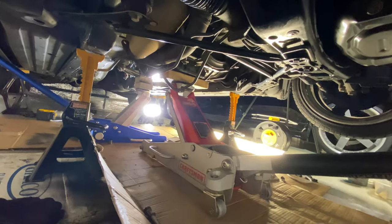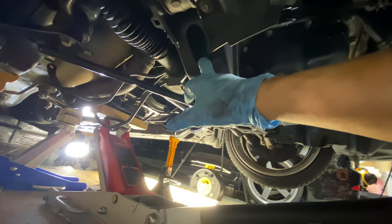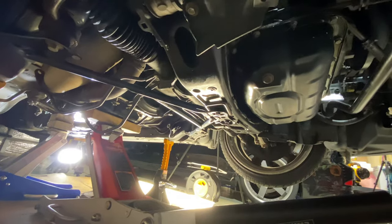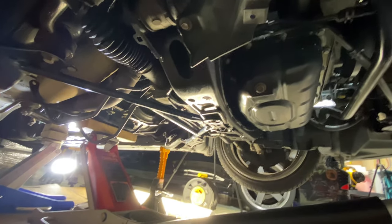I made myself a little transmission platform stand with my jack — I used that same one-inch pin I had for the transmission jack, drilled a hole in a 2x4, and I'm going to use that to hold up the transmission while I take the rest of the bell housing bolts down and slowly lower this baby down. Now that I've got all the bell housing bolts unbolted, I'm going to re-tighten these engine mount bolts since I don't need the engine to tilt anymore.